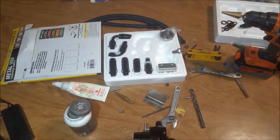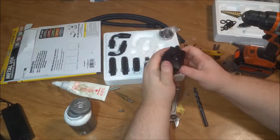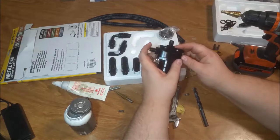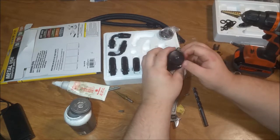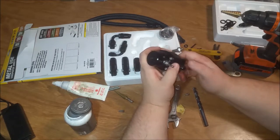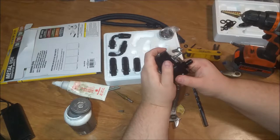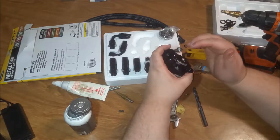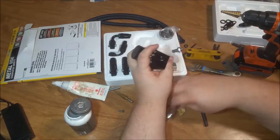But I know the current regulator on my truck, because I got one of them 450s, has it on the fuel rail. But it's just a little pinhole, man. Now this is a bigger hole, but nonetheless, I don't think that's enough to regulate that much fuel. I mean, we're talking a return of 5/16. I don't even think that has a chance, and for that matter, it's not going to do it well. It's going to open all the way up to get fuel through there, whereas this one is just going to hover. I like this better.